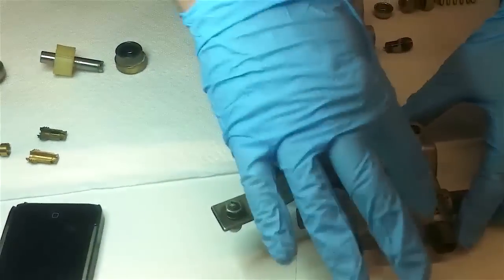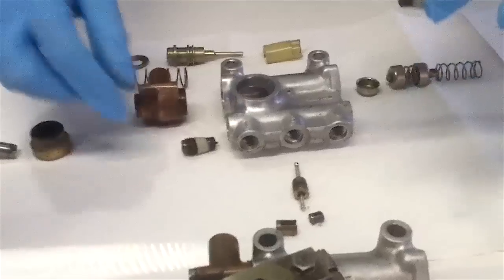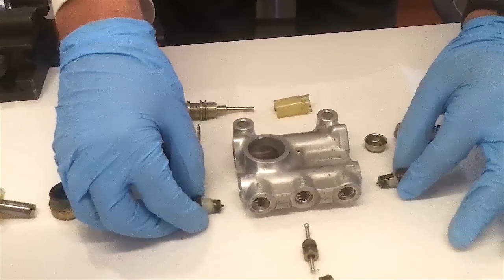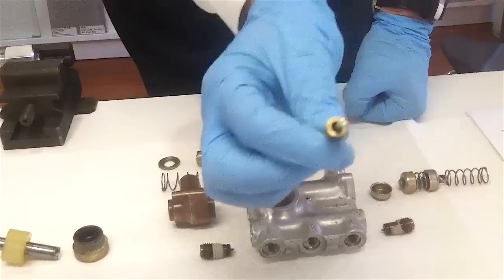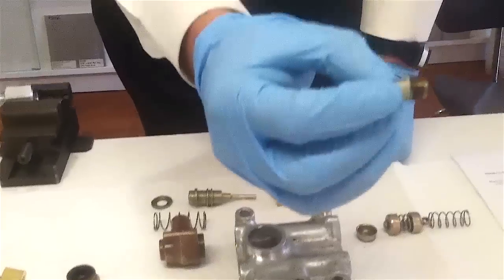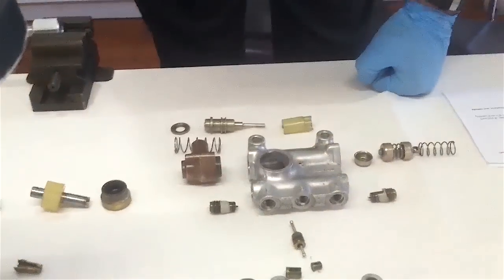The work group is quite simple. In a regular car you have a steel spring on the side; this is replaced by an airbag — it's like a ball, an air tank with a rubber part under pressure replacing the spring. The work group also consists of the airline tying into the bellow (B). Any of these yellow-marked parts have to be airtight. If they are not airtight, your car is going down. The critical parts where these valves commonly leak are the STK, the A valve, and the intake valve. If any of these three parts leak, your car will go down.